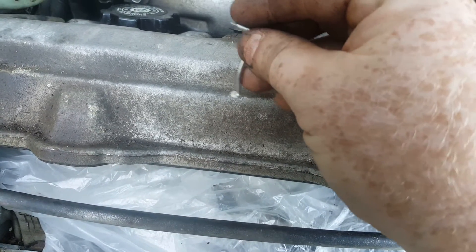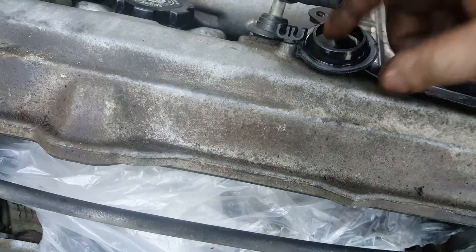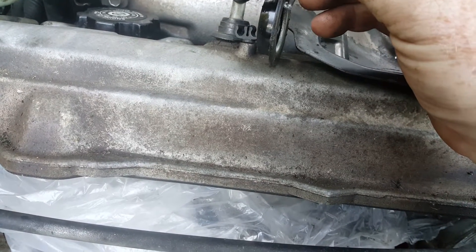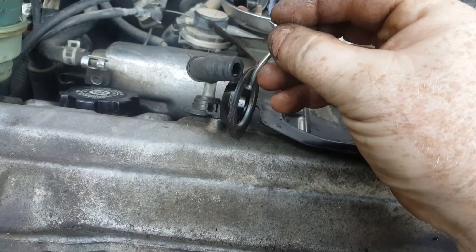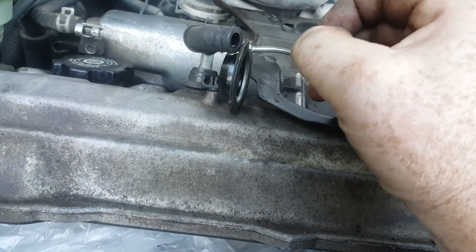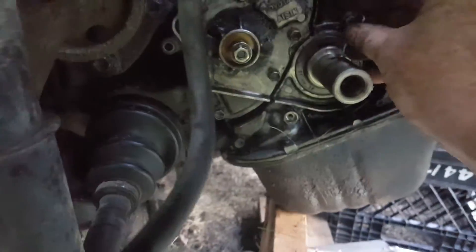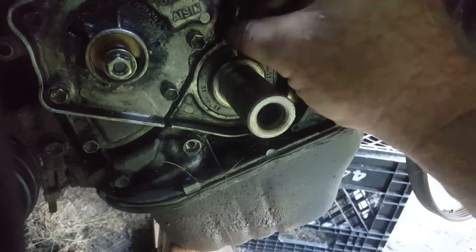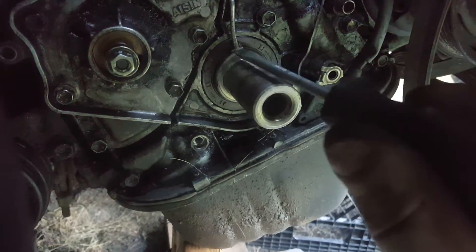This is how it works: you go up to the seal — pretend this is the seal — and you drive it into the side of the seal or along the lip of the seal, then pull down and it locks underneath the lip of the seal. So you get to your seal, put it in — you might have to tap it in with a screwdriver on the flat side, just gently — and she's tapped in pretty good.